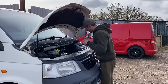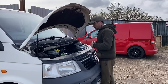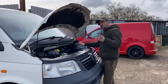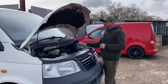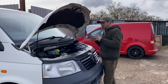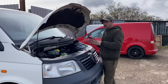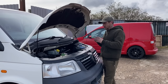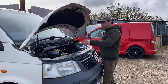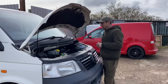We've got to do something about the engine — it boils over and it leaks water. I mentioned at the start of the last video I thought it was the EGR cooler, but it had absolutely no EGR cooler at all, and it's probably the head gasket while it's pressurizing. A few comments mentioned the water pump — apparently the impellers on the water pump come off. So next video we're going to swap it out for the PD140, which is the slightly stronger engine. If I'm going to build a van, I want it to be ultra reliable, and this engine's done 282k. I'd rather put a lower mileage engine in that I know is never going to break down. When I pull the engine out we'll have the water pump off, have the head off, and find out what caused it.